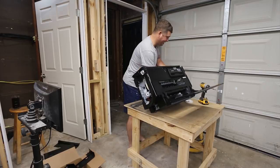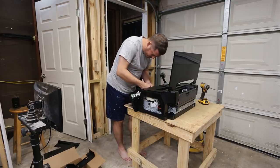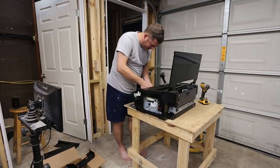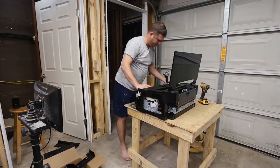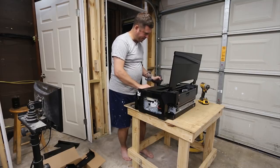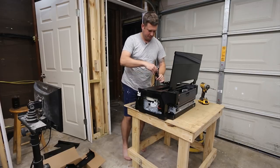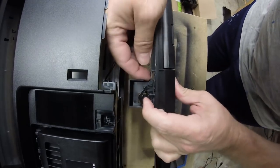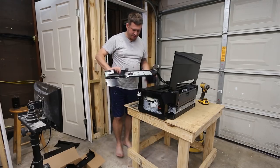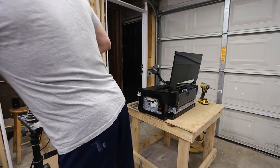Once you've released that, you've still got some stuff to gently remove. There is a small cable here that needs to come out, and you need to very carefully work this out — it is twisted on here. Then you carefully get this off and remove it, setting it off to the side. We will need this again; it has the LCD and the buttons that run the printer, so set it in a safe place.